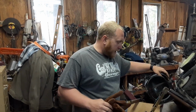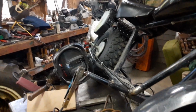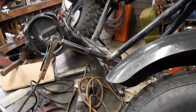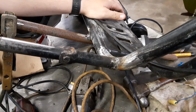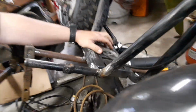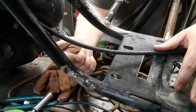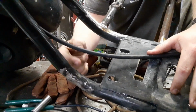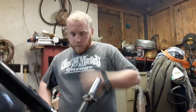Alright guys, I know we had a plan with taking flat metal and kind of bending it around and forming it, but we tried that and it's too thin, and I don't think it's going to give it any kind of strength. It's just going to cover holes up. So we figured out we would just take the old peg, weld it back, cover the hole up, clean it up. And I've got some metal that I'm going to put between these bars. And I can do it down here also, to try to get where this weak spot is on this side because of this welding and everything. Tie these bars in for cross members, little square tubing that I've got. That should help strengthen it back up. But we just wanted to give you a little update of what we were going to do, and let's get this thing wrapped up, and we'll get back to you here in a little bit.